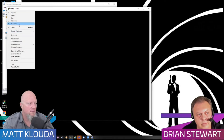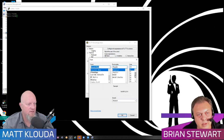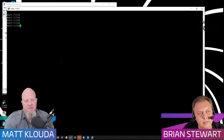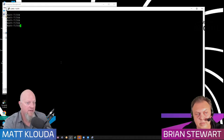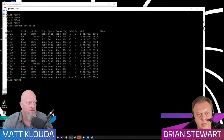And one thing I'm going to do on here as well is I'm going to go to the settings, appearance, and I'm going to change this font so that we can all see it. Okay. So we need power on the port. Okay. And my access point is plugged into port 1/1/3. Okay. So if I do a show interface brief, it's going to show me all the interfaces in the ICX, and I see 1/1/3 is up.